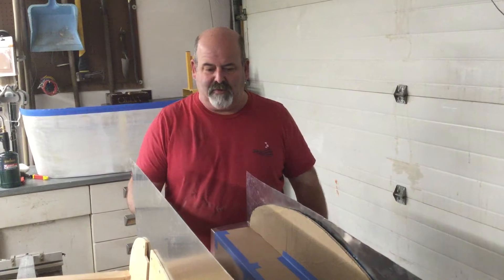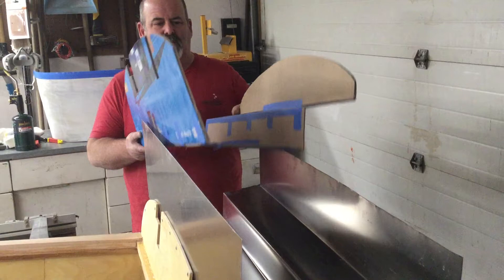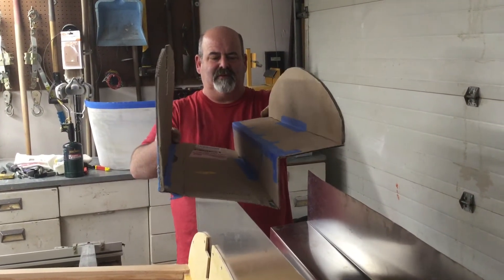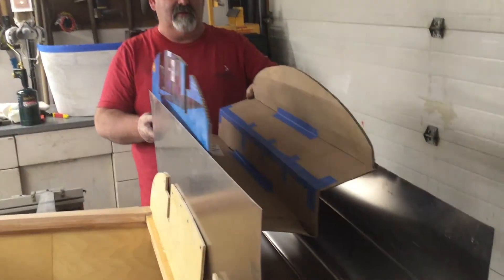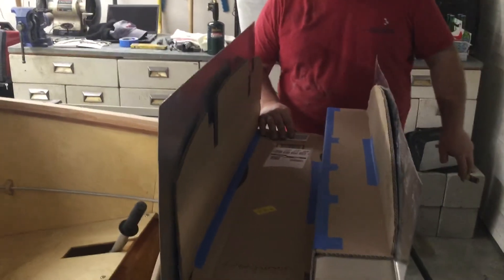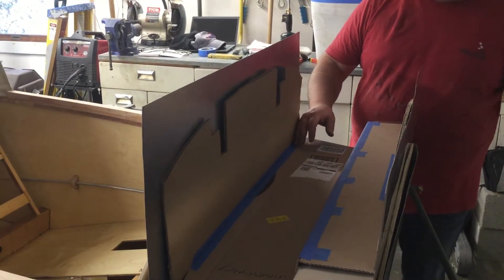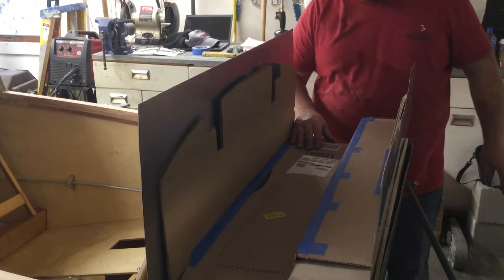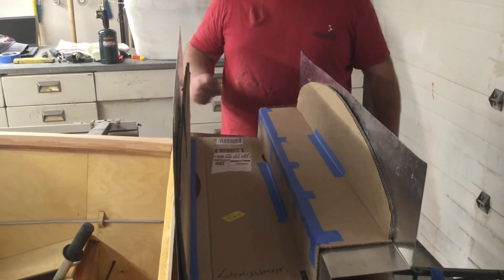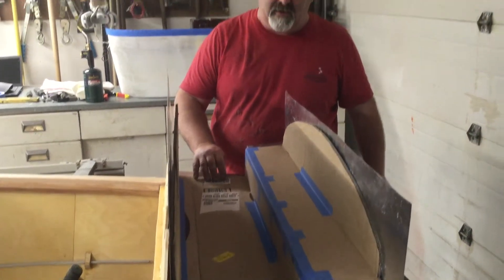Last week we made a cardboard template for our custom gas tank. It's going to sit in the nose of the fuselage here, so that's essentially the rough shape of it without the top or the sides. Then we just took some aluminum sheet metal and used a brake to form up the rough shape. So now we have the contour right. We've just got to cut it to fit width-wise — it's on a little taper, so we decided to do that after we bent it up rather than doing that first.